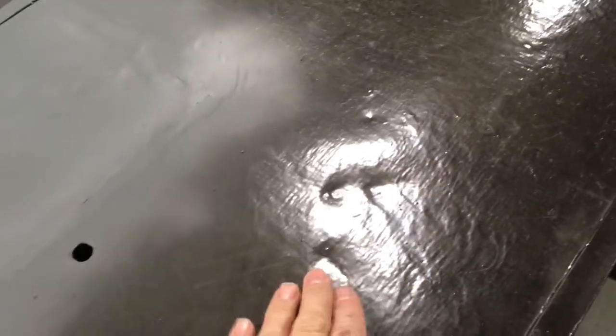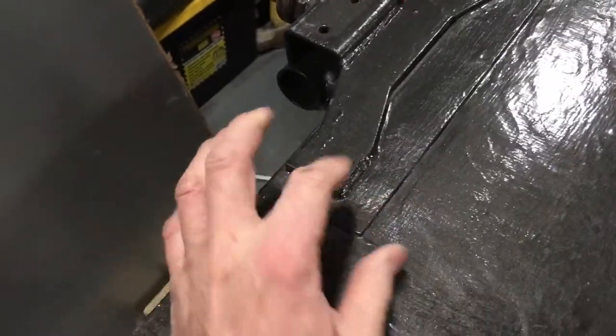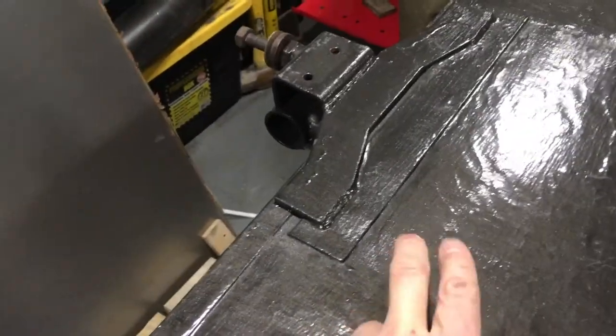And actually there's quite a few of these little metal stiffener plates inside, some of them are not spot welded, but they're all 1mm steel. It's like a cardboard box. It's strong when it's all squared and folded, but the actual steel itself is quite soft. So the actual steel, I wouldn't say it's soft, but it's not strong. And again, you've just got stiffeners all over the place here where the suspension is mounting. You've got these thick plates here onto this thin steel.